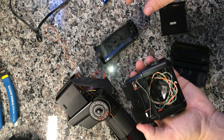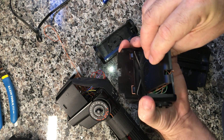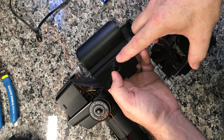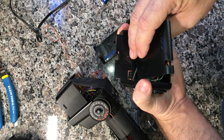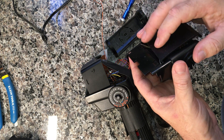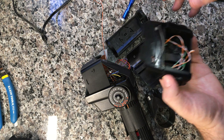The only really nice thing about this system is that the flash head comes off by opening the battery door up. There's a button on the bottom which you'll be able to access to push down and kind of separate it a little bit while that's separated. You flip it over with the battery door open, and if you push on these two tabs, you can slide the flash head off carefully. Once you do that, you'll have access to the bare xenon bulb and you'll begin to get access to the internals of the battery pack and so on.